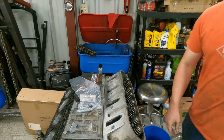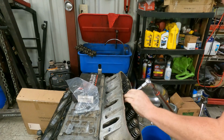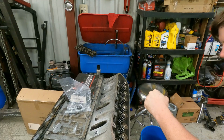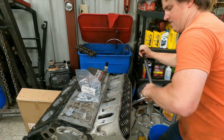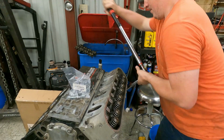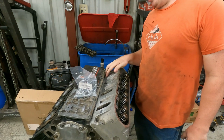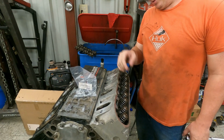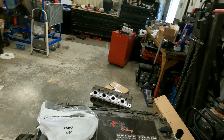All right, everybody's torqued to 22. Bring it back for 90s. All right, 90 degrees. All right, that's another 90. That's 90, I mean. So now I'll go ahead and do 70. I don't think y'all need to be in here for that. So we'll do another 70 on that and bring you back when we go to put the other head on. Probably not going to torque it in the camera frame. So bring you back in a bit.